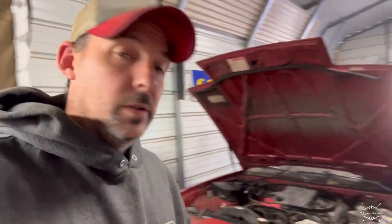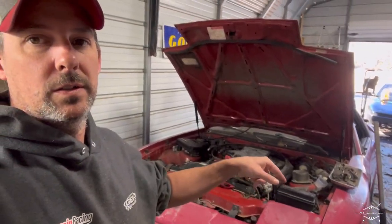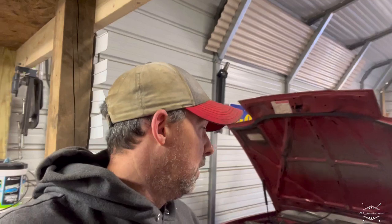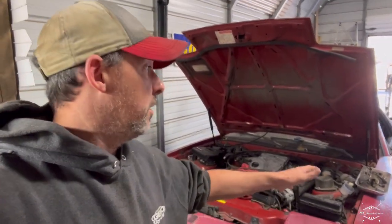Okay y'all, it's been a couple days. Look — got all the hoses, got the timing belt down there as well. So we're going to start on this thing. I'm going to get it on top dead center — pull a plug out, turn the crank, get on top dead center, all that good stuff. My goal is to get this thing done and out of the garage today.